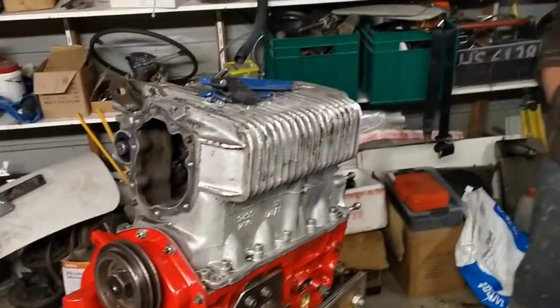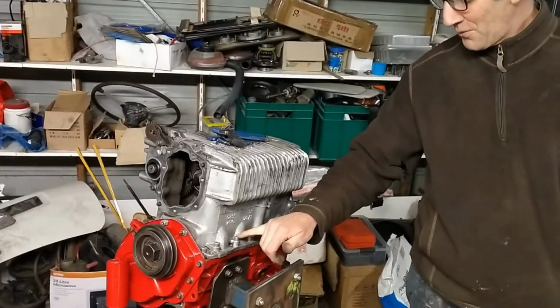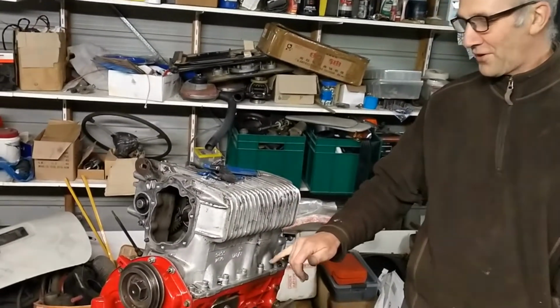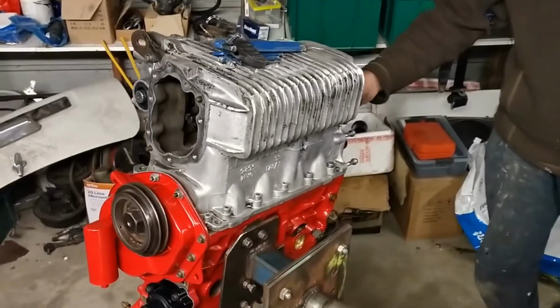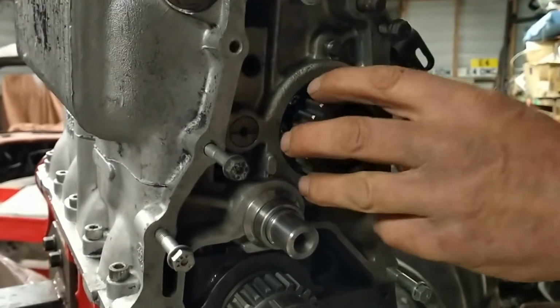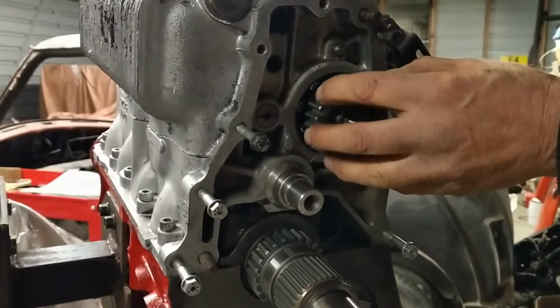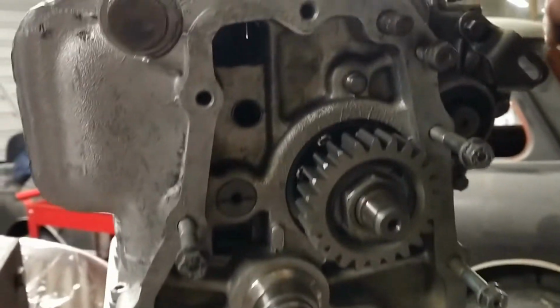Hi guys, just bolted the gearbox finally onto the block. So bigger size bolts on here. I've actually used Allen head cap heads on there, but they're a slightly bigger size because this is one of the areas that's prone to leaking on these. All Mini owners know. Gearbox, if you come around the side, have a look. It's an MED kit again. God, I love MED. Set of drop gears on here, and it's a straight cut gearbox as well. It's got all new bearings, shims, everything, the whole lot. It's just been completely rebuilt, and the diff is a cross pin one as well, so that's uprated.